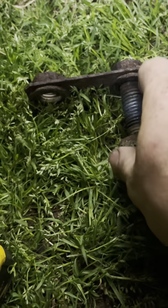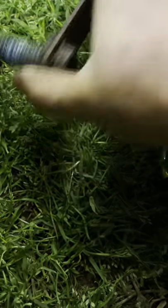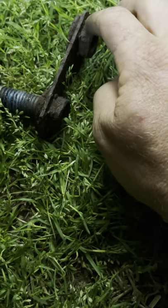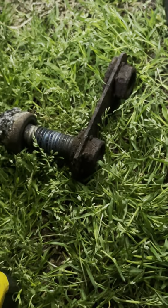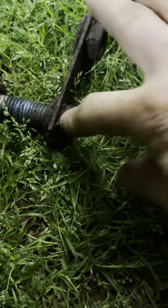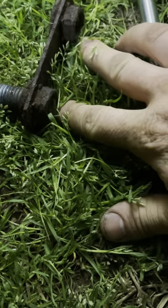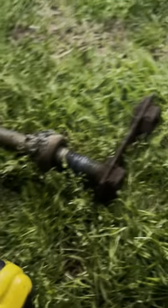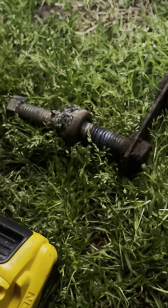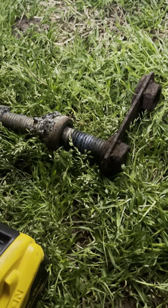For the new nuts that are going on here, I'm going to use a piece of grade 60 rebar — which is real stiff, non-bendable — and weld it to the nuts on both sides. That should be enough to make a new similar bracket. This is what's up inside the C-channel frame that the bolts thread into, and that's what keeps those nuts from spinning. If you use an impact tool on here, there's a fair chance you're going to break that little connector and end up spinning the heads. Please do like and subscribe to the channel if you'd like to see more similar videos.